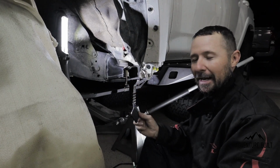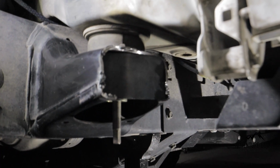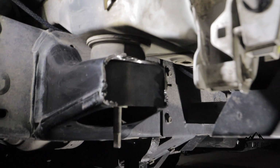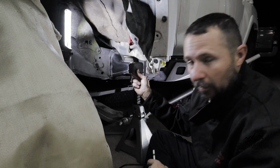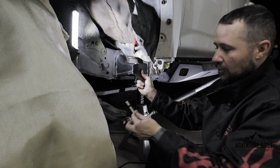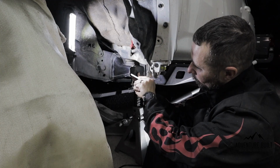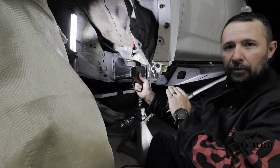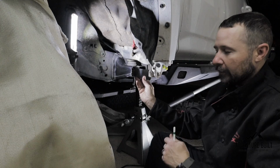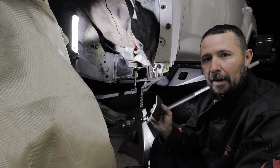I've got the rough cut made. I can actually get the plate inside of the bracket. And you can see that it's really close. I need more clearance on this inside right here. So I'm going to take my pencil and mark where that clearance needs to be, and then go with the cutter wheel and cut that tab off, and we'll get it closer. Once I get that cut done, we'll clean it up with the flapper disc and we'll get this thing in.